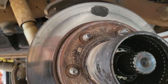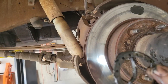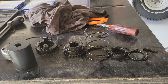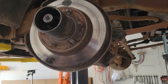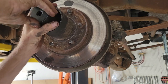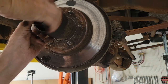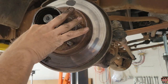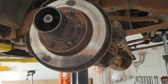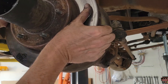You can see it's got the tangs in it as well, and here's the washer that goes in between the nuts. Again, I'm putting everything in order. This inner nut should just be about hand tight — yeah, it is. So this comes out, and once you get this nut out, the rotor and hub will come off at that point. Then this hub should come right off — and there's the hub, it is off.